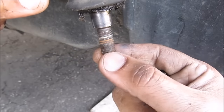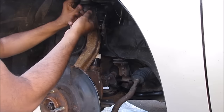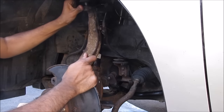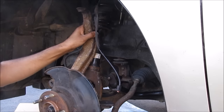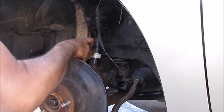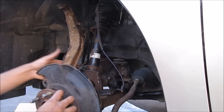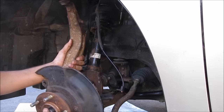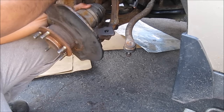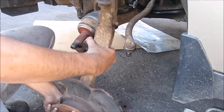Now if you had to cut off your cotter pin like mine, you're going to have to drill a new hole in there before you put in a new cotter pin. The last thing holding the knuckle on is the upper ball joint, so we're just going to remove the castle nut and let the upper control arm be released. Then we can remove the steering knuckle — you just lift it out from the lower ball joint and away from the axle, being careful not to pull the axle out of its sleeve. Then remove it from the lower ball joint and that's the knuckle free from the car.